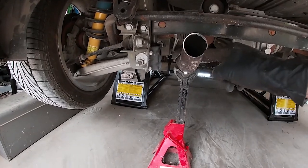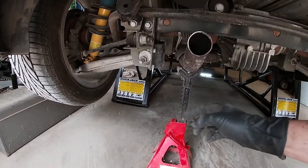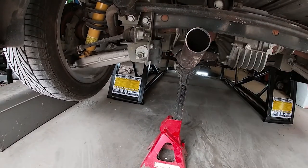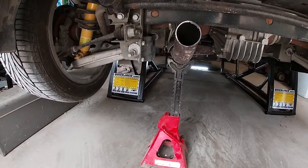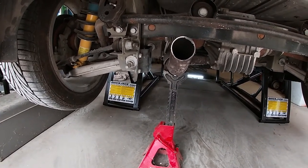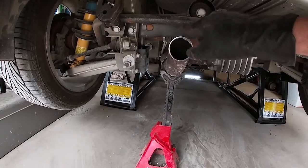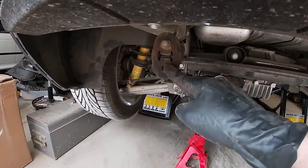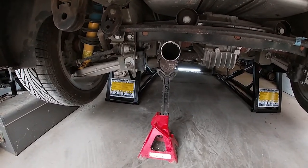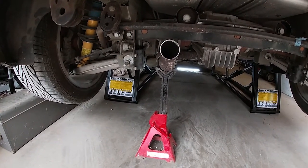So here's our new exhaust point, and I've got a mount point right here. So I'm gonna probably just put a hanger right on the bottom, go right off to the side there. That should hold it up for now. And then eventually I'll take this thing and bring it back. I don't think I got enough free pipe handy right now to do that, but I'll just weld it up, make a straight pipe. Second hanger there, race exhaust. That is until we get a bigger turbo and other stuff, but this guy's gonna do a season in stock form first.